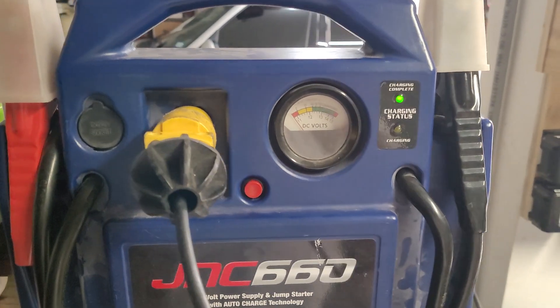The other thing I found out when I tried to jumpstart the Silverado that was super dead: the battery I bought has an over-amperage protection built into it. Essentially what happens is you try to jumpstart a vehicle and the battery will turn itself off, which is not very convenient given it's a jump box. The workaround to reset it is to plug it into the wall and start trying to charge again, and the battery will then turn itself back on internally — electronically, if that makes sense.